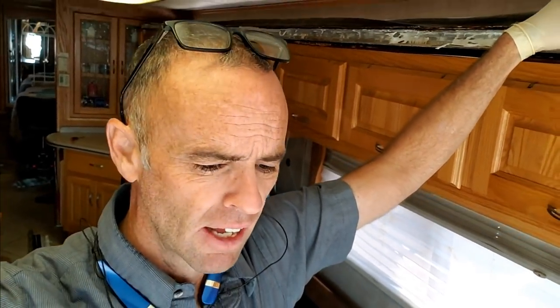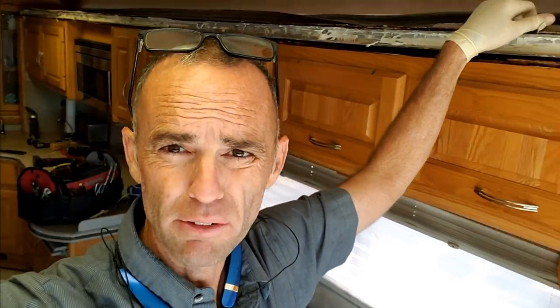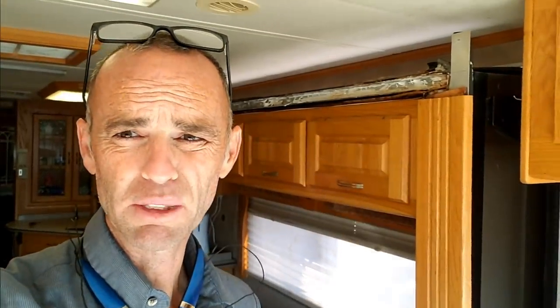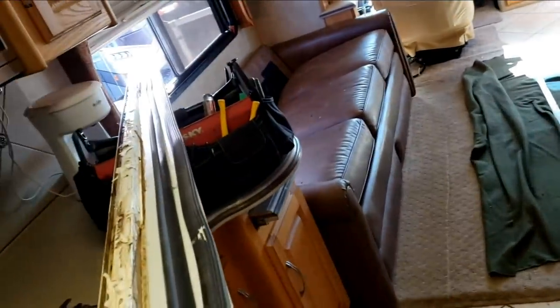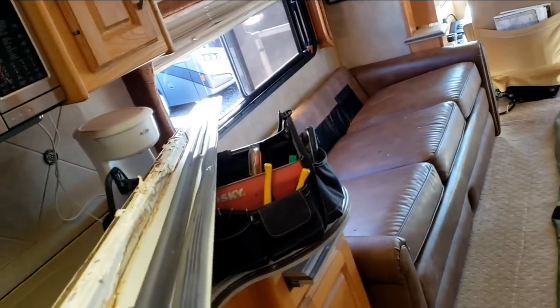I talked to the owner and he wants me to do what I feel is best. We're going to remove that angle, rivet the roof down, seal over the top of everything, and probably put a new top wiper seal on — because once it comes off it's a one-time push-on seal. The side ones you can do later easily; the top one you have to have the topper off. First thing is to clean that face up really well, then clean up this slide out top. I'll get this out through the window and rest it on my tool bag.